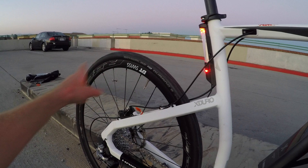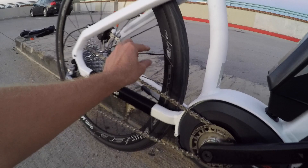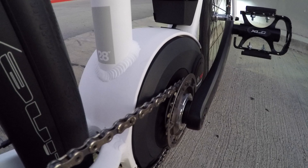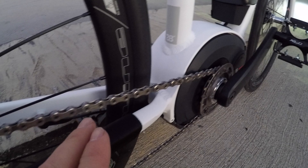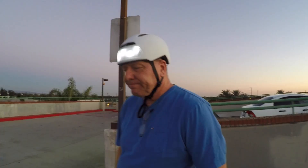The DT Swiss rims are sort of deep dish, double-walled with bladed spokes — really nice. There's a lot of detail I've put in the written review. The hubs are both DT Swiss. In the rear there's an 11-sprocket SRAM Rival cassette, and up front a 20-tooth narrow-wide sprocket. The teeth alternate narrow to wide and fit more perfectly between the chain links, so you get less slipping. The Bosch system measures wheel speed, pedal cadence, and pedal torque roughly a thousand times per second.